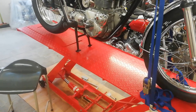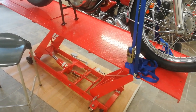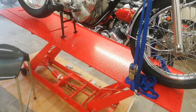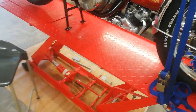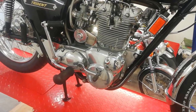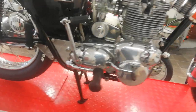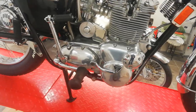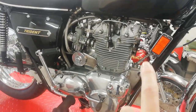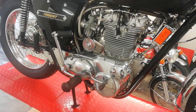They're not that expensive these days — this one was under 300 pounds. You can raise the bike to whatever height you want, no groveling around on the floor. When I'm finished with it, it goes flat and I put it against the garage wall so it doesn't take up too much room. I've also got a three-into-one exhaust, which means I can't have a center stand, so I've removed the whole exhaust system — it's just one nut at the back and three clamps, comes off in one piece in about two or three minutes.